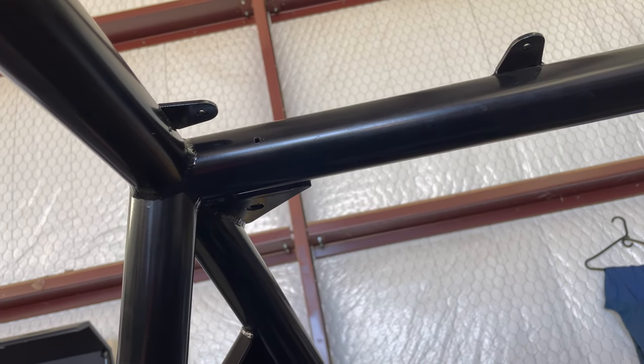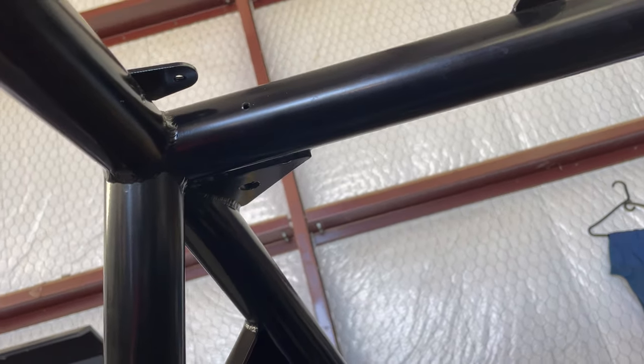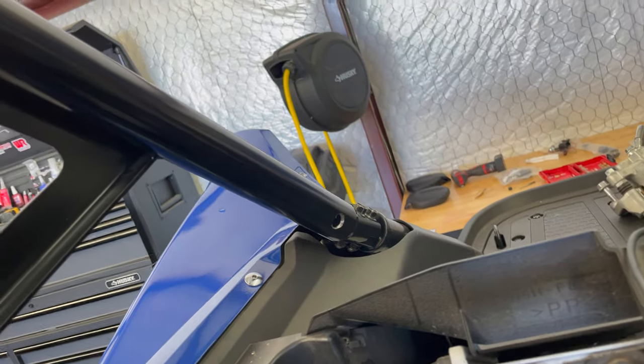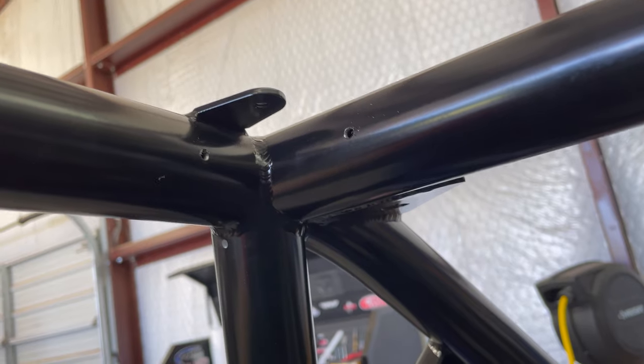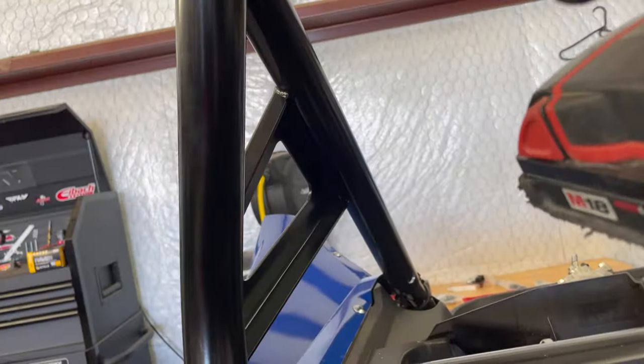All right, so my step bit is just not quite strong enough. So what I'm doing is I got that one down there at the base. It's the right size now. And I just did a pre-drill with a small bit, like an 1/8 inch or something. And then I'm just stepping it up with regular bits now.